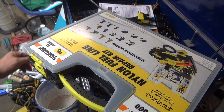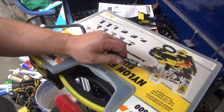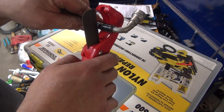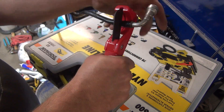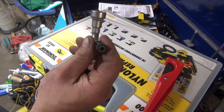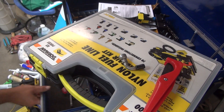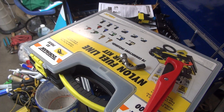Dorman is usually junk but this kit has been pretty good. I'm gonna cut this off - it comes with this little cutter. I'm going to cut it off right there. I'm left with a little collar on here so I'm gonna get a utility knife and see if I can cut that off, because I'm trying to save as much of the line as possible so we're not stretching it when we get it on there.